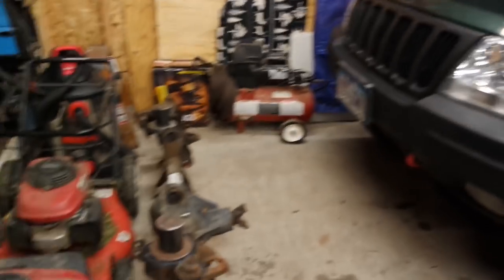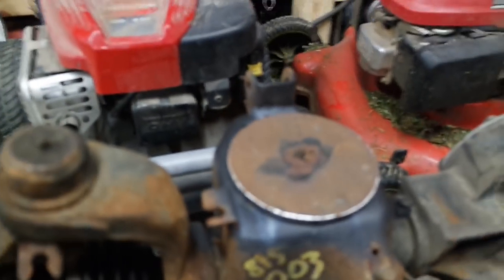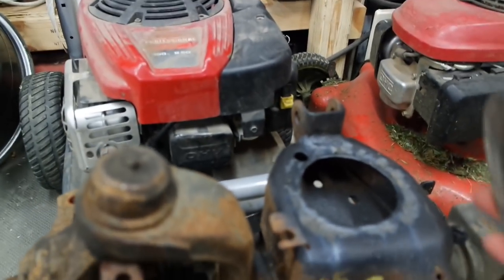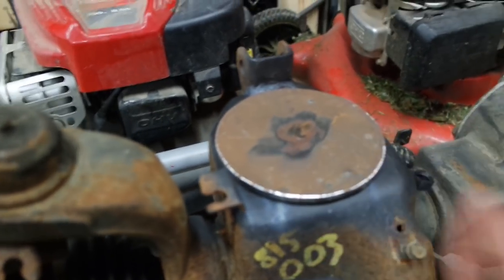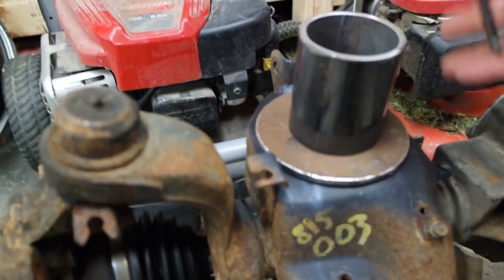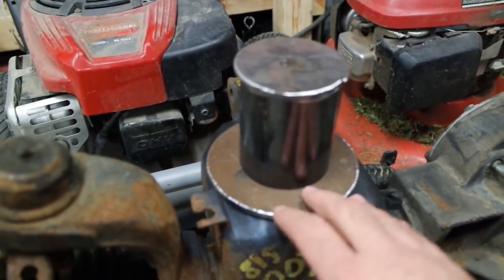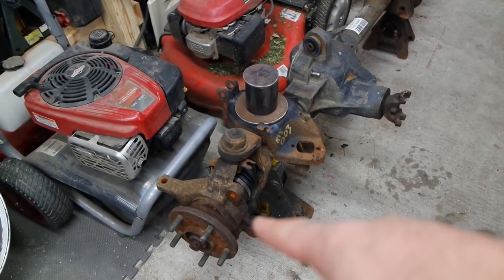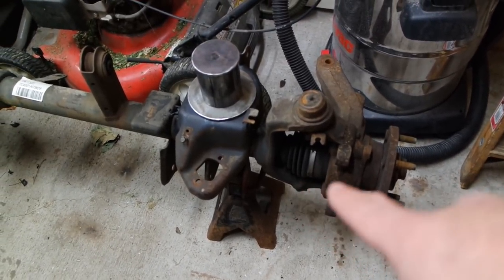I've been filming the work on these axles, so that will be a separate video when putting them in. You'll notice a big issue on these is the spring perches rust away. I've got some quarter-inch plate — they make kits for this but it's pretty easy — and I'll give you guys the exact measurements in the video where I'm putting this together. I've got new hub assemblies to go on both ends. I'm going to pull the axle shafts out, take a look at the boots and feel the CVs. They're actually not that expensive — it's like $100 for a new set of aftermarket OE shafts.